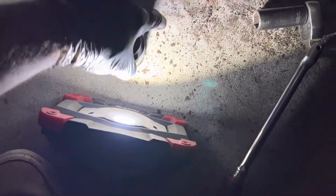The smallest cup is too big to fit on the ledge right here — that's where you need to press on to. Since the whole control arm was up and down, I tried to use an air hammer and it wouldn't work. What I found works great: get yourself a one-and-three-eighths inch socket — that fits perfectly around this collar.